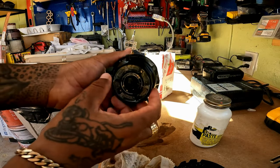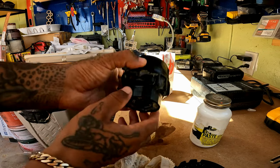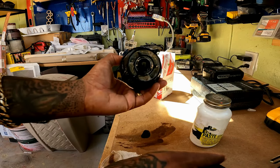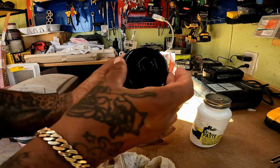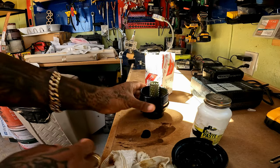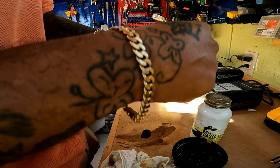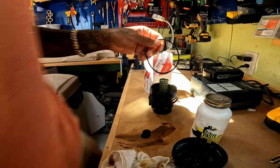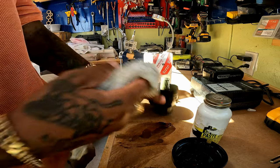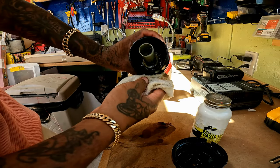Here's a close-up of the bottom of the filter. Some people like the plastic style, some people don't — the point is to unscrew it. There are four keys: one up top, three down below. Here's your oil filter wrench, which goes on the same way and fits a three-eighths drive. Don't forget to remove the O-ring on the old filter — use a pick or whatever you've got. That O-ring is what does the sealing. Clean the little groove it goes into — make sure there's no junk in there.